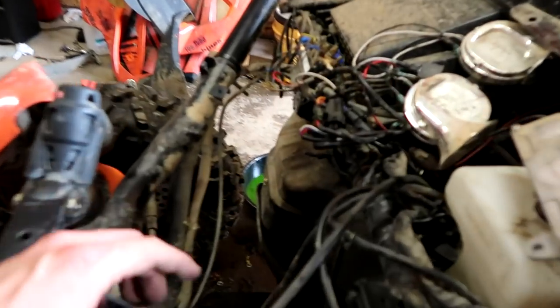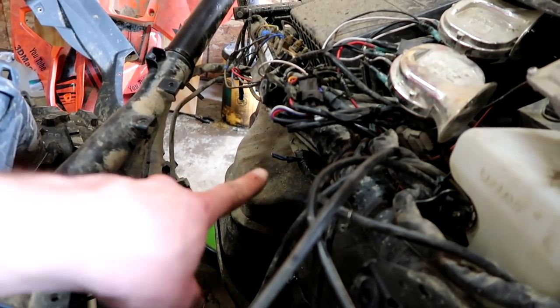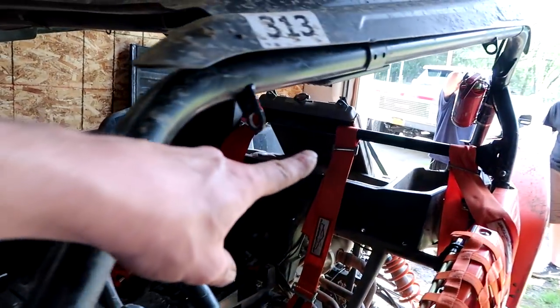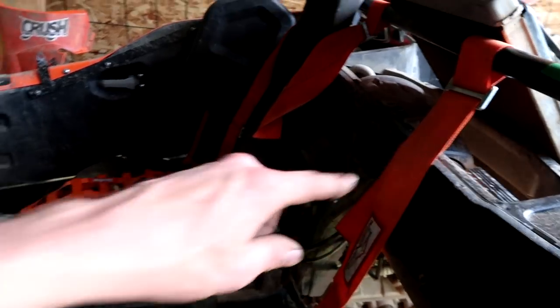I originally told Jason I wanted the radiator right up tight to this piece of plastic, but you can see there's about two and a half inches of gap. If I put it right tight to the plastic, the radiator wouldn't be able to breathe as much on the bottom part. We also have to elongate the wire going from the original connection to the new radiator location, running it down next to the transmission and back up.